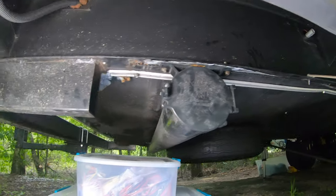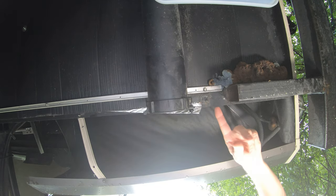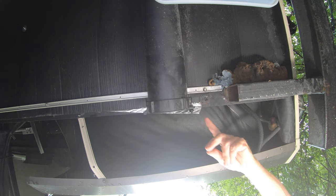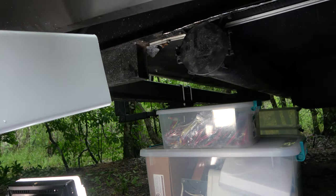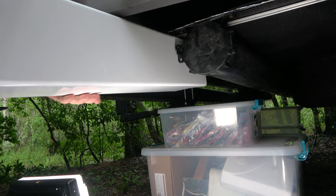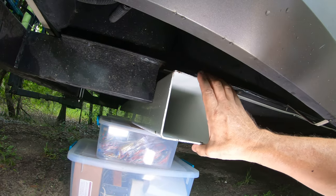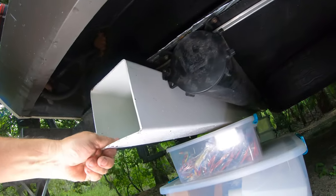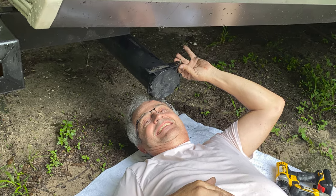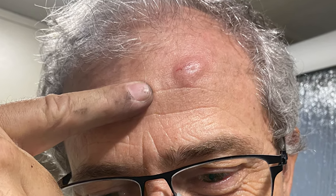I was mounting my five-by-five DIY tube beside the DNW tube that came on the RV. I had to move that down a little bit to make space between the spare tire and the bumper. When I first moved the DNW tube, I didn't have support containers in place and it ended up dropping right on my forehead, creating a big lump. So make sure you use something to support the tube when installing it.